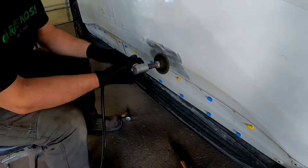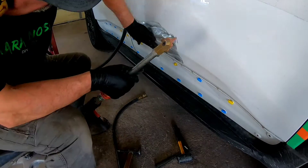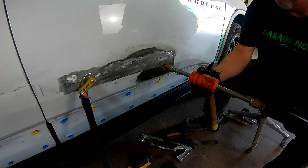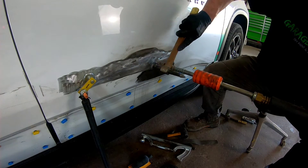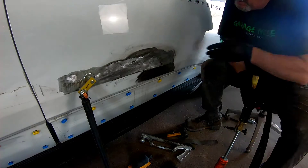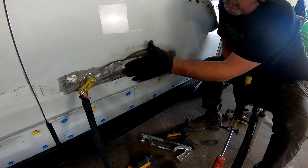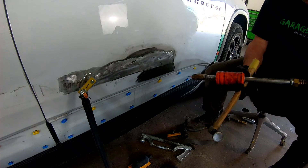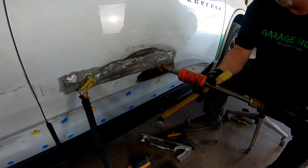We've done as much as we can to push out those dents from the inside of the door. Now we need to remove the paint, so I've got my angle grinder with a 36-grit roll lock disc and I'm just going to grind the paint smooth. Then I'm going to use a tool called the G90E — if you haven't checked out the video and demo on this tool, check it out, I'll leave a link at the end. I'm going to use this to weld onto those low areas and then tap down the crowns and high areas around it to level out that metal. We'll pull out these dents and then move on to the rear door.